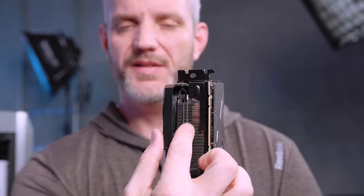I've tried to come up with other shim ideas in the past because I knew that's where the card sag was happening, but I tried shimming it in the back — you can see when I wiggle the card you get a little bit of in and out back there. I tried to pull it down to get opposite cantilever action, but I need to do that even with the weight of the cables. EVGA's tabs are opposite of everyone else's so I kind of flip them around. These are the little things that make me wonder — who went into the CAD and removed the third tab? It was there on the 20 series, EVGA — why'd you take it away? But look — even with the weight of that, it's still sitting perfectly level. I could even loosen these up, hold it up, make it tight, let it sag to level — boom.